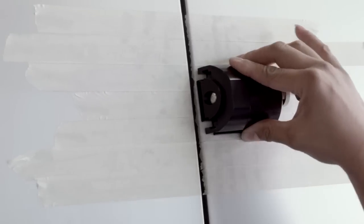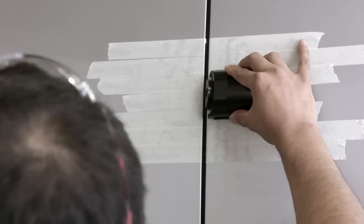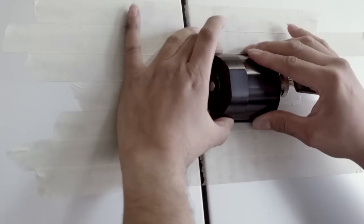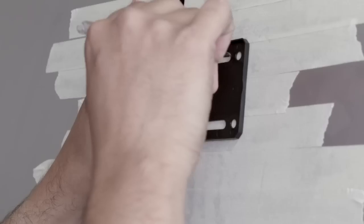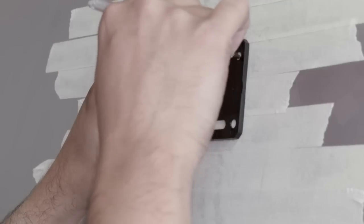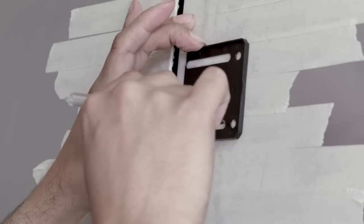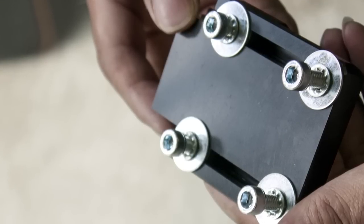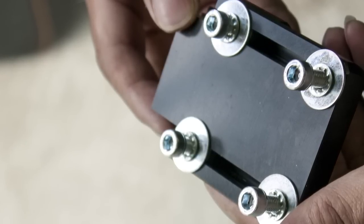We can now open the side sliding door to ensure there's no obstruction. At this point, we can manoeuvre the lock body to find the most suitable clearance position. Once confirmed, we can remove the unit and, whilst holding the gasket in position, mark the two holes and the two slots on the masking tape. The ArmaDLock requires four fixings to be utilised on both sides for optimum strength.